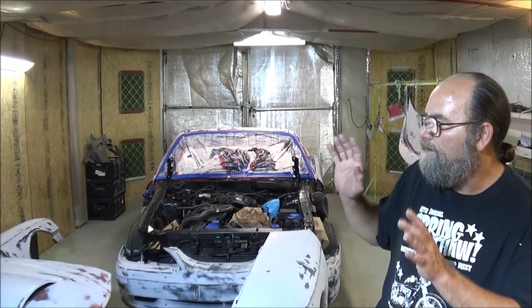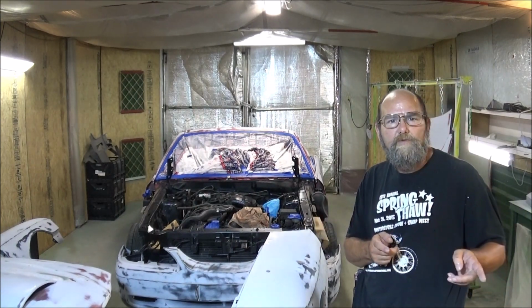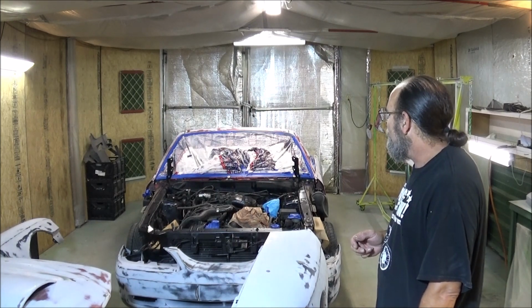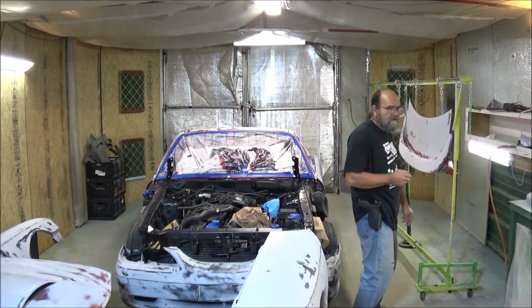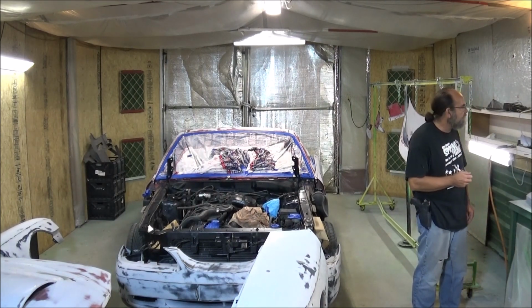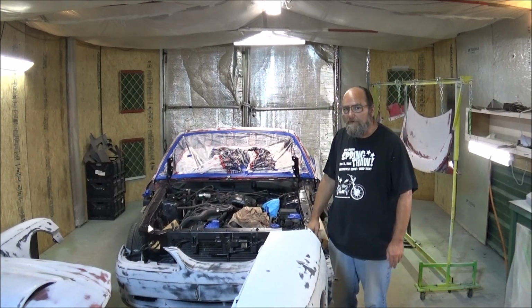Alright, let's head out here and I'll show y'all the gun I'm using. Let's get our paint mixed up because we've got everything else done. The compressor's been drained and filled back up with air. This fan's been on for about an hour or so. I was out here at 6 o'clock this morning. Right now it's about 7:30. Man, we're still at like 85% humidity, but it's right at 70 degrees. I think that's about as good as we're going to get, so we might as well shoot this bad boy.